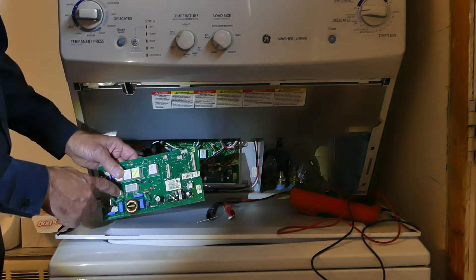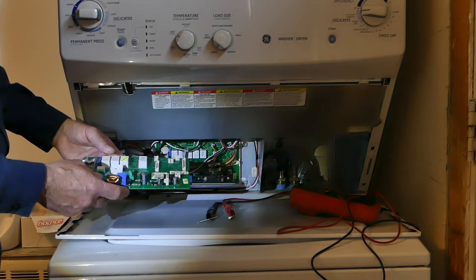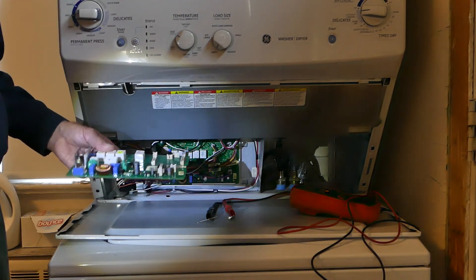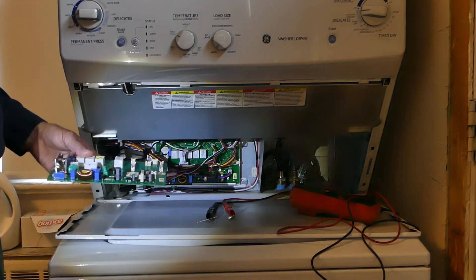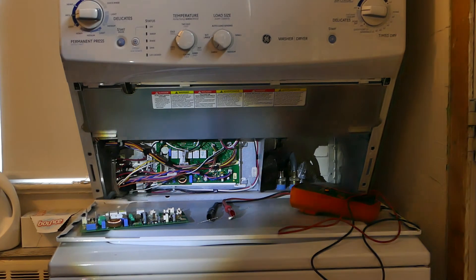You've demonstrated power in, you've demonstrated that there is regulated voltage operating your sensor, so at least some of the board has some life to it. So why doesn't it come on? At this point there's nothing else you can check, so you condemn the board — and there's a new board right there. Problem solved.